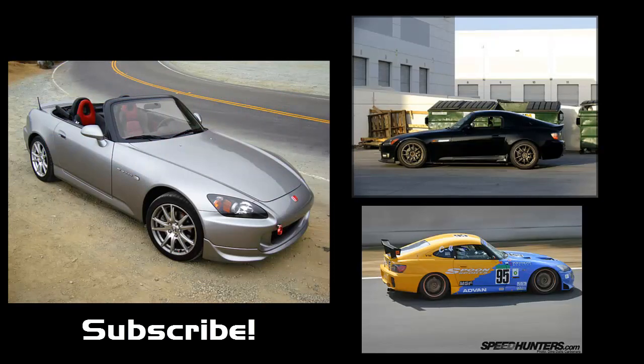So the conclusion from our findings is that the Spoon hardtop will decrease your drag and make the flow more stable, which will decrease your buffeting at high speed. However, you do need to add a rear spoiler or rear wing to make sure that you don't generate more lift than the OEM case.